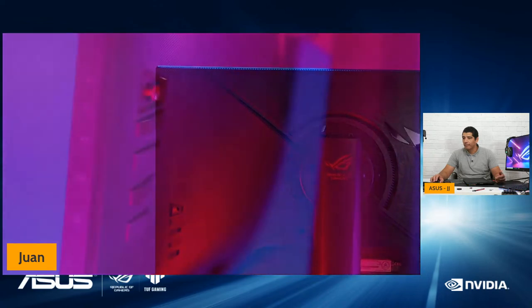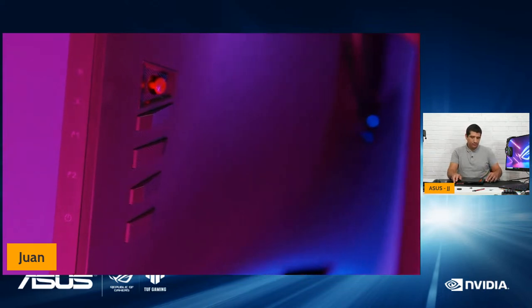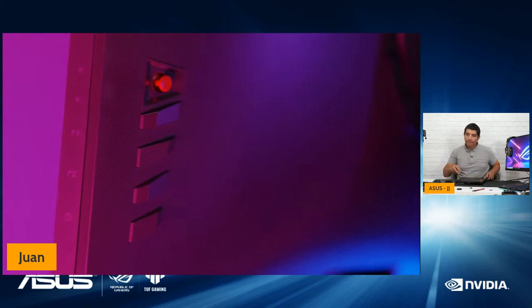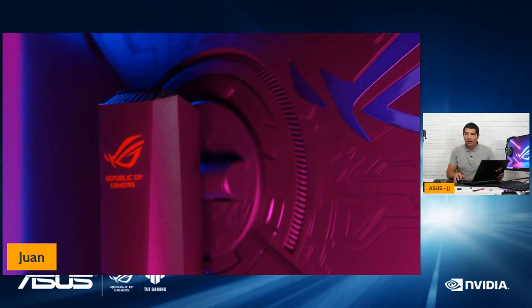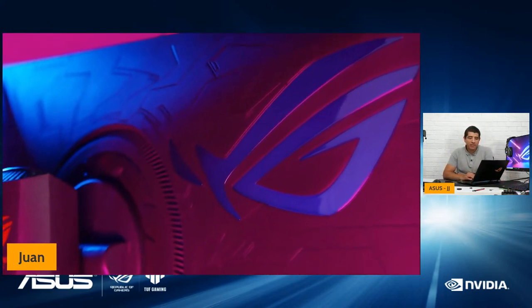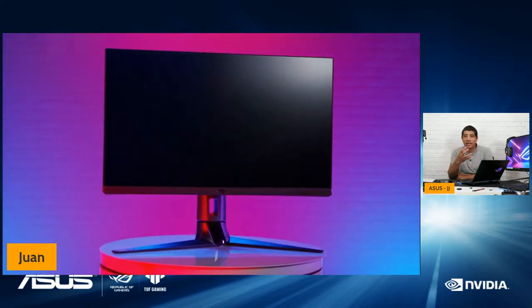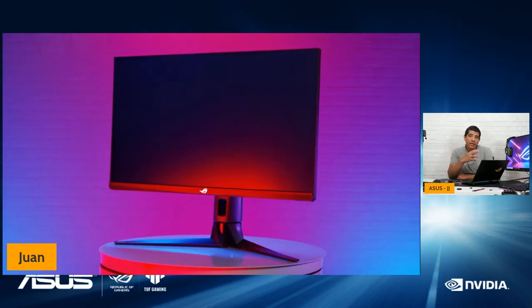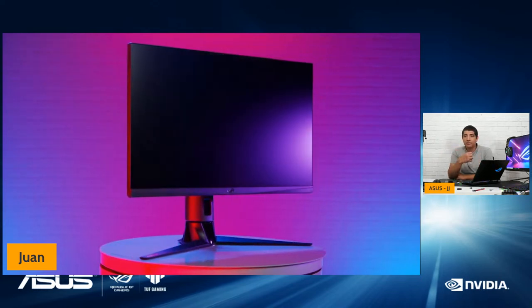Now, just before we move off of that, was there a reason for the division between USB-C and HDMI, that they were ported to different graphics processing units? Technically we could do it on both, as far as putting the discrete, but it just depends. In this scenario, we've tried to implement that to offer flexibility depending on the output configuration you want, from a more performance oriented pursuit versus a more battery oriented pursuit. So having default connections that favor one versus the other.